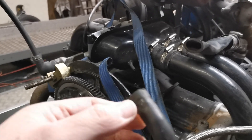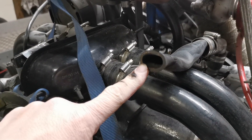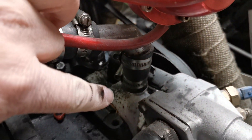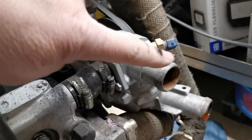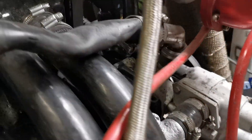The filler section from the Honda fastens onto this pipe here, which runs down through what I think is the thermostat housing, into the water pump itself. Then you have the flow and return to the radiator, and the connection to the head on this side. On the other side, a little further into the head.